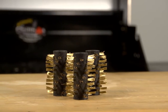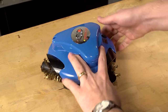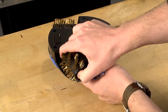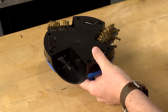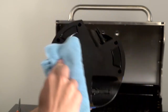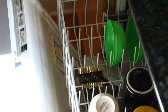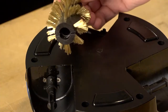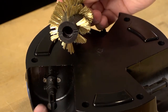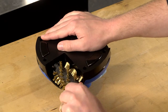GrillBot will let you know when cleaning is complete by shutting down automatically and emitting an audible beep. Now let's talk about brushes. To clean your brushes, remove them by holding GrillBot upside down. Grip the brush by the ends and use your thumb to press the release button on the outside and remove the brush from the axle. Wipe the bottom of your GrillBot using a damp cloth or degreaser. You can place the brushes in the dishwasher or rinse in soapy hot water. After the brushes are clean, simply line up the notches with the slot and snap them back into place by slipping the brush back onto the motor shaft and pressing until the brush clicks into place.